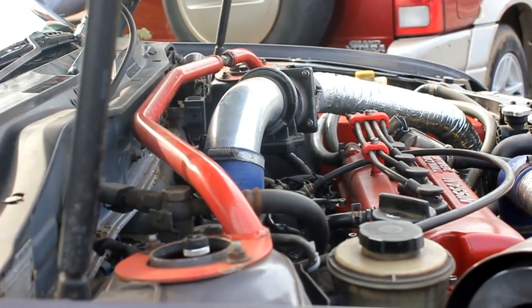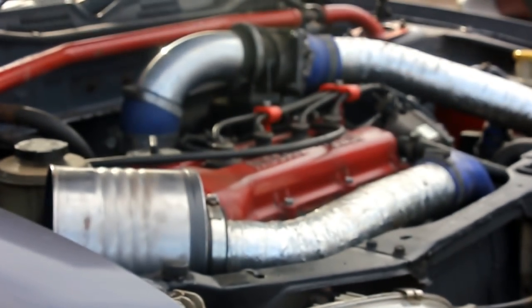I find a sweet spot on the pressure to give me the most contact patch and reduce the flexing as well. Dampers are set to the track setup, so it's like 15 clicks in the front and 30 clicks, which is maximum hard, in the rear, so it's twitchy at the back. Absolutely. But then just check fluids and the usual after that, really.